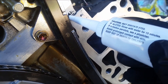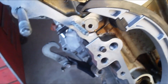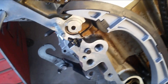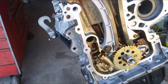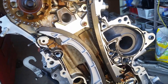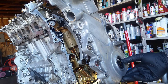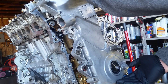Right here at the upper block and lower block where they meet, the surface is not quite flat. I put some extra gasket sealant in those areas to make sure they seal properly when the timing cover is placed back on. It is okay to have a little extra sealant rather than not enough — if you don't have enough, you might have a leak. If you have a little more, then when you put the timing cover back on, the excess gasket material gets pushed out and you can wipe it off.